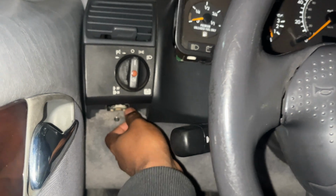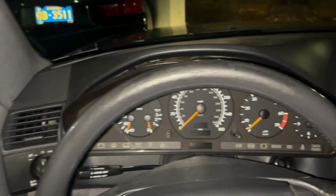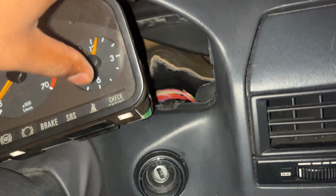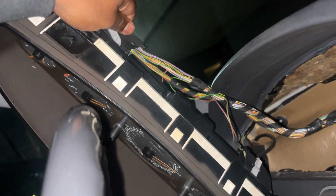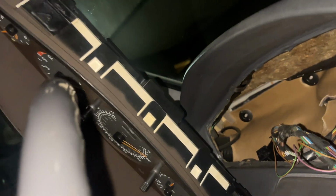Ignore the fact that my parking brake handle is missing, and that my steering wheel needs to be replaced. We'll fix that later. But for now, see, I've pushed it out slowly, can reach up here and pull it forwards, and now I can access all the connectors right back over here, which come out pretty easily. With the two connectors, you have to push a little tab at the very top, which unlocks this slider, which, as you can see, if you push it forward, the connector comes right on out. We'll do the same on this side over here. And now the cluster is free.